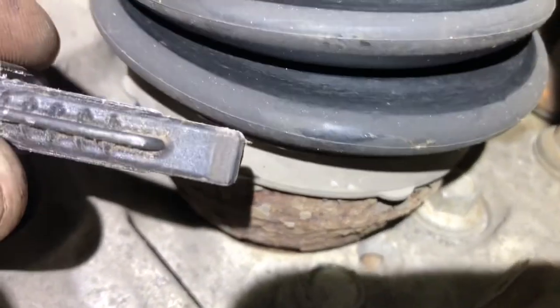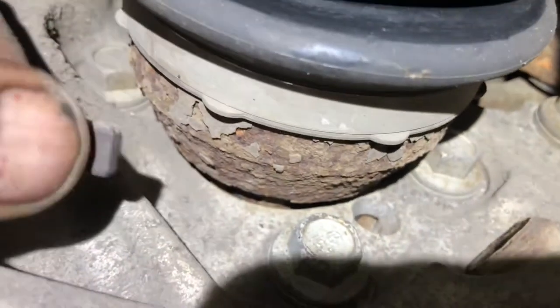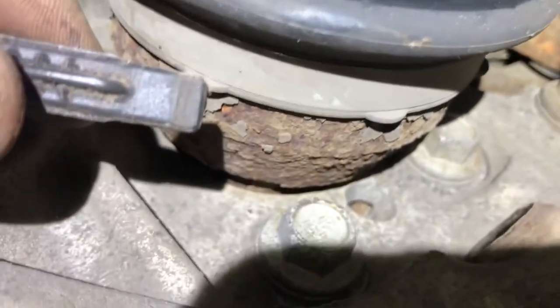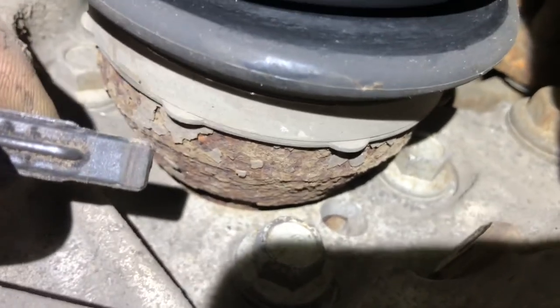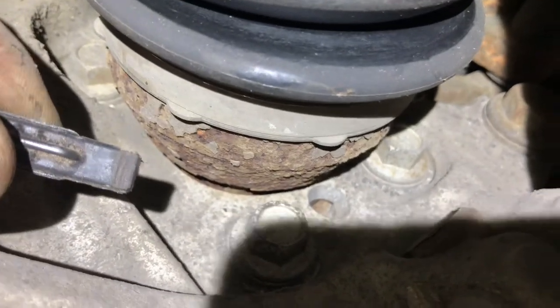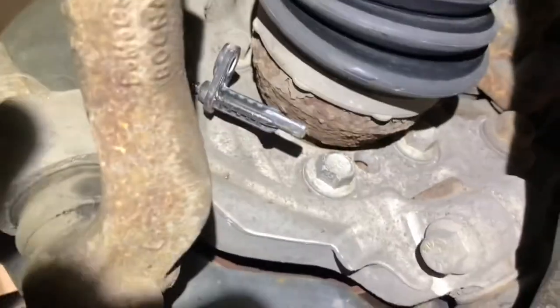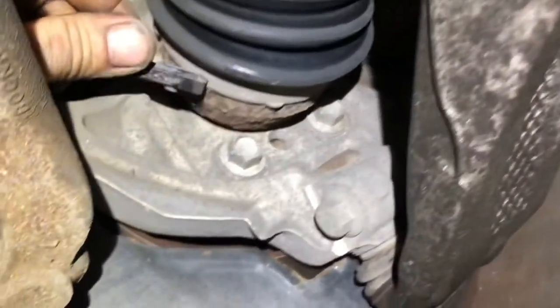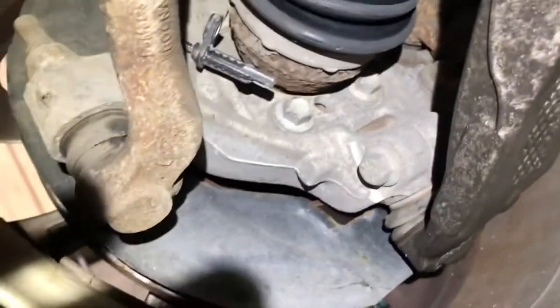You can actually see where the bearing was rubbing off the actual sensor. It's that surface area there. That's what's making me call sensor and the bearing, because it looks so bad inside the borescope and because of that rubbing mark. If we change just the sensor, the rubbing mark will happen again from the other sensor. So it needs the bearing and sensor.